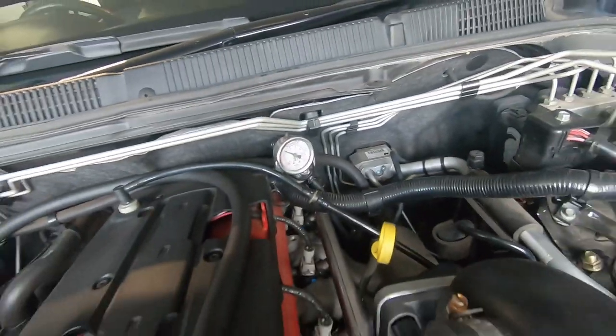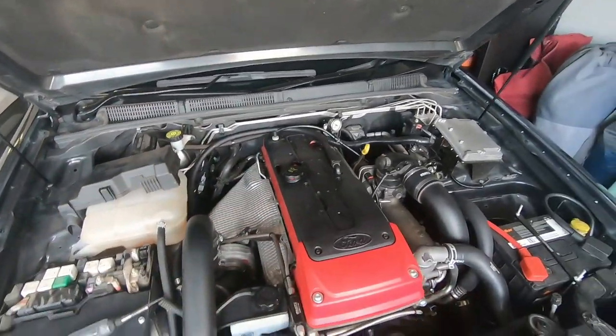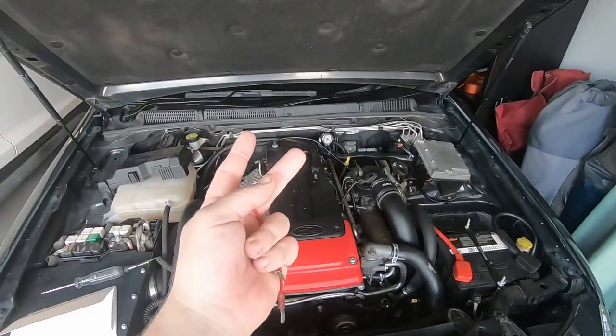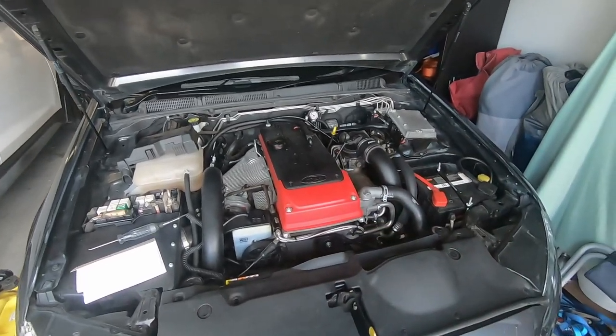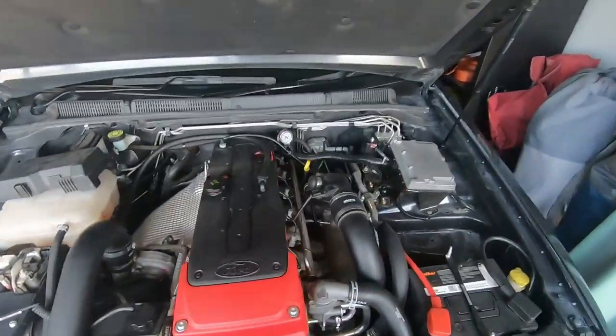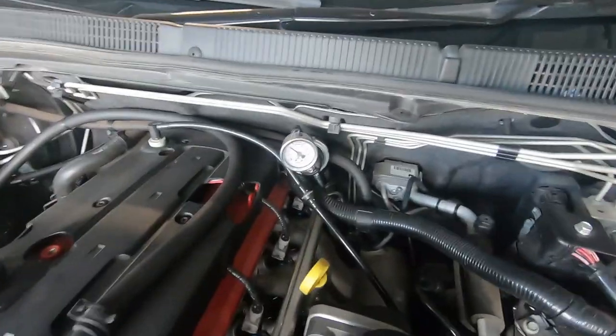I was having a bit of a whoopsie poopsie because I wired them around the wrong way. So if you saw when I pulled it out, I had a jumper wire put in there. I wired it to suit that, not the actual thing, so because I took that out, it didn't start up, so I had a bit of issues. It's a brush motor, they'll run in reverse if you wire it wrong. So we had to get Jaden here to fix that. I had a bit of a mind blank. But yes, now we've got fuel pressure.